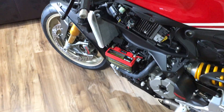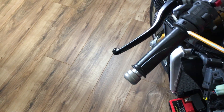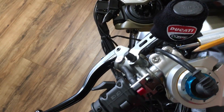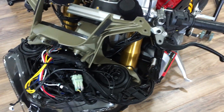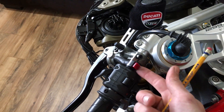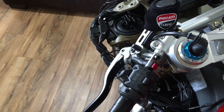The last mod I did — it gets cold up here in the Pacific Northwest, so I put in heated grips. I just did the porcelain resistor type. You just pull your bar end out, slide them in there. I put some thermal paste on mine just to make them conduct a little better. The wires come out right here — it's a pretty clean install so you really don't see it too much. And same thing — I did a relay off the headlight. Be sure to power it from the battery; don't try to pull the power for the heated grips off of the headlights, but you can absolutely power your relay with it. So the bike has to be on, the low beams have to be on, and then the heated grips will work.